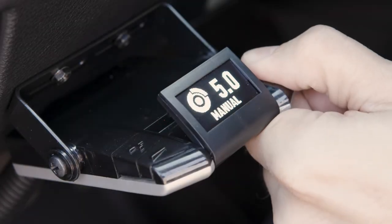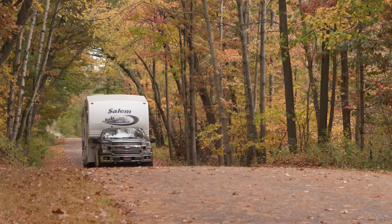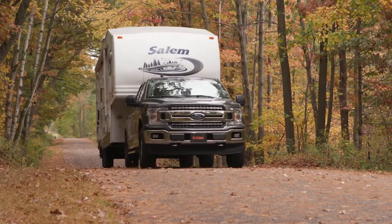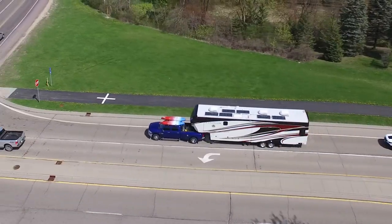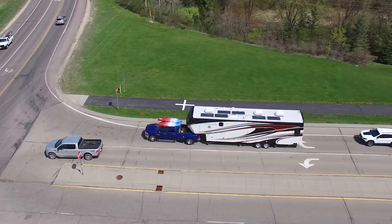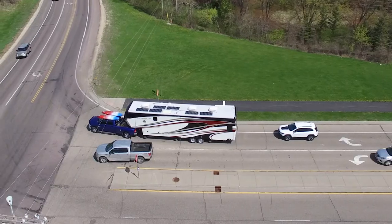The manual control button on the right side of the controller is a tactile button. The more pressure applied to the button, the more aggressive the trailer brakes are applied, with no effect on the vehicle's brakes. This is useful for gradual slowing on steep grades or before a stop, and it can also be helpful for controlling trailer sway.